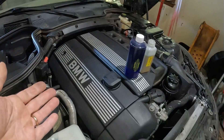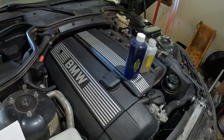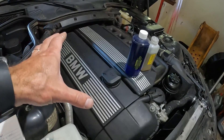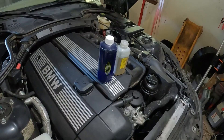So what does it mean to blow a head gasket? It simply means that there's a compromised section in the gasket, or it might be a compromised section in the cylinder head, or a combination of both. In the case of my M54, this is most likely an issue between the head, the block, the gasket, or the head bolts have separated and the threads are lifting, which relieves the tension of the head to the block and allows the gases to get into the cooling system.